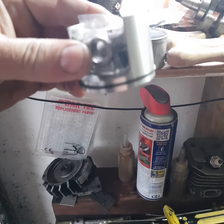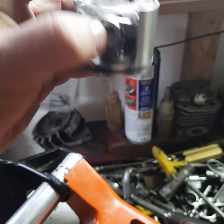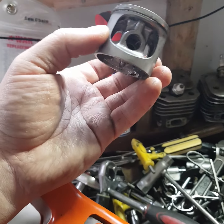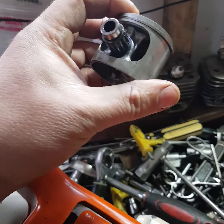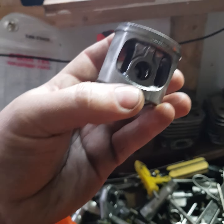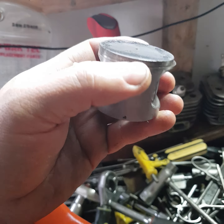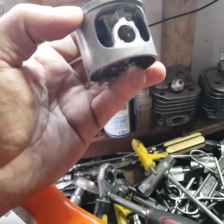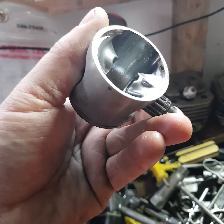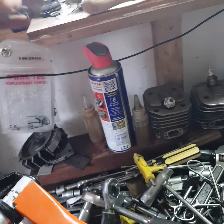I have a replacement Meteor piston for the 266. This was the original one. I'm afraid I couldn't find this setup, because you see it has better support on the skirt at the bottom, but I'm afraid this piston is worn a little bit more than I want. And obviously original, this is Mahle, it's not Kolben Schmidt.